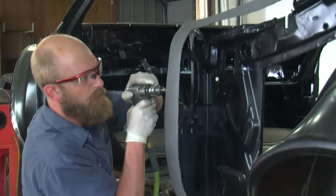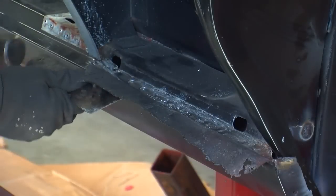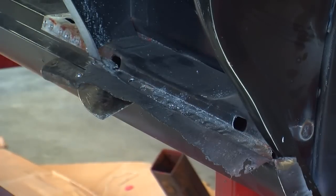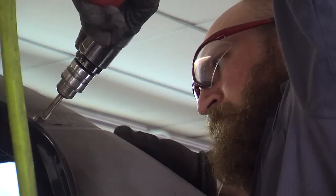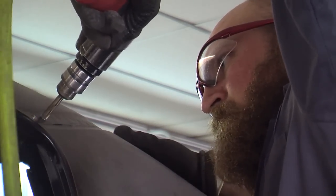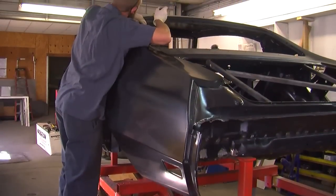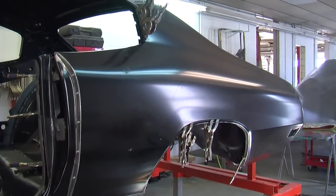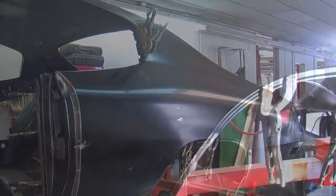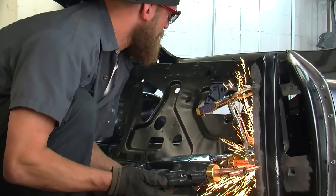Adam uses a variety of tools to remove the old steel — mostly spot weld drill bits. I also like to use a putty knife and a hammer, which cuts through spot welds pretty easily. They also make spot weld breaker bars that work pretty well. I drilled out all the factory spot welds to remove the existing quarter panel, then hung on the new quarter panel basically just with clamps and sheet metal screws. It's a lot of clamping in one spot that moves it in another direction — you go around the quarter panel four or five times before everything actually fits right. Once comfortable with how everything fits, we just start spot welding it back into place.